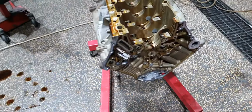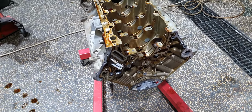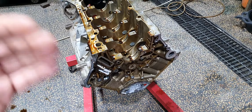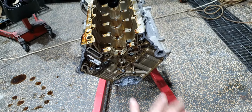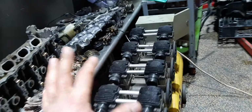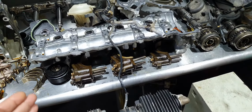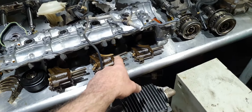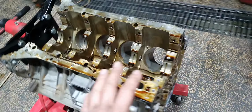Let's go again outside. So, back to the engine. Why am I saying to change the crankshaft bearings? As far as I know, the agreement is for a used engine: to have one healthy used engine, put it in. If I use these bearings, yes, it's gonna be fine. Yes, it's gonna work, definitely. But it's not gonna be ideal. It's gonna be much better if we change the crankshaft bearings, the connecting rod bearings, thrust washers, okay? To have peace of mind.